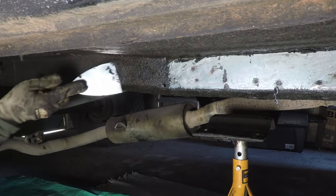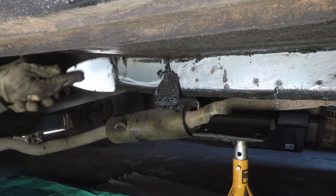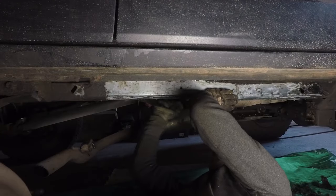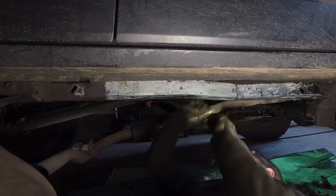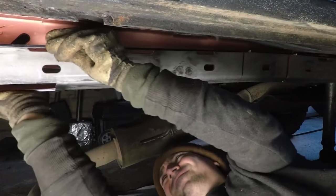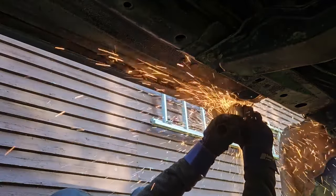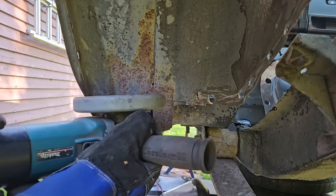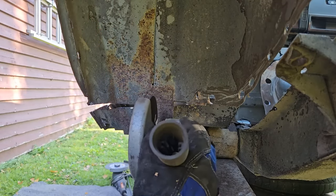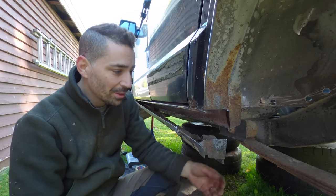Frame stiffness. If you're going through the motions of wire wheeling, blasting, or scraping all the undercoat off your vehicle, isn't that a great time to be putting frame stiffeners on? Absolutely. You wouldn't want to be spraying all that underseal or spending money on POR-15 only to have to remove all of that work again to put frame stiffeners on later. If you look at the four litre out there, it's in a prime state to be frame stiffened - I've got the box rockers out, floor pans are out, it's been cleaned up and it's ready for welding.